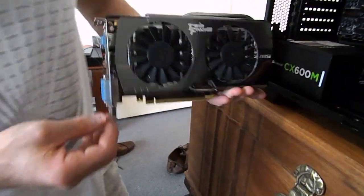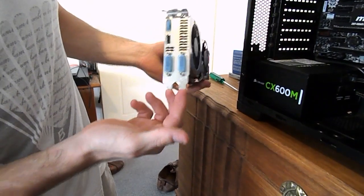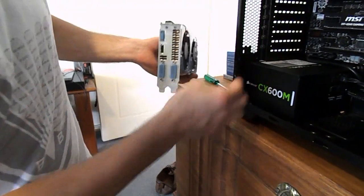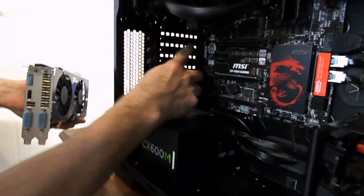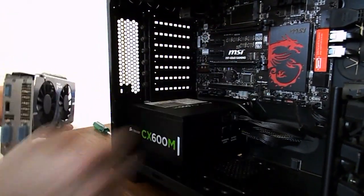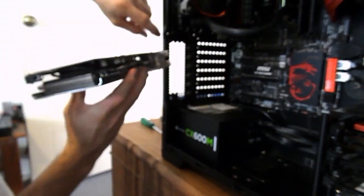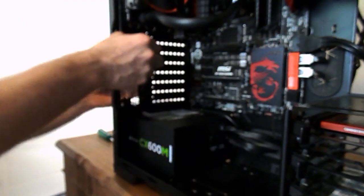People who have graphics cards, most decent graphics cards these days, guys, will be dual slot, and this is obviously an aftermarket one by MSI, so it's got that open cooler on it. So make sure you take out your PCIe little expansion cover bays, guys, and make sure they correspond to the correct slot on your board. So starting from the top, you'll have that corresponding to the connector, and the one below it as well. And that will be the same with reference card designs usually, guys, because they'll need room for their blowers on the bottom. Take them out, guys.